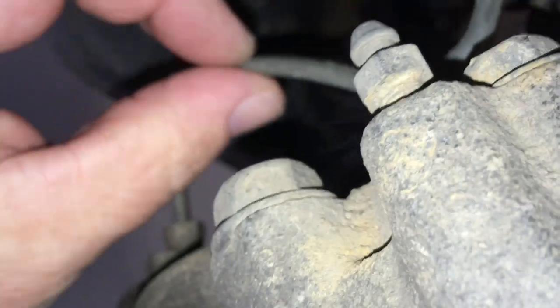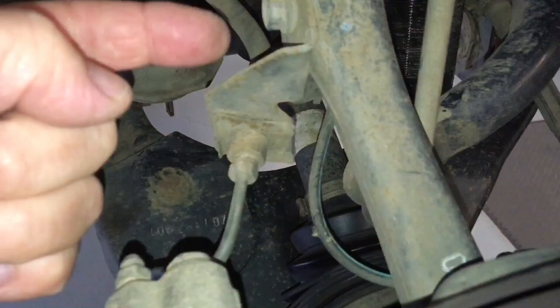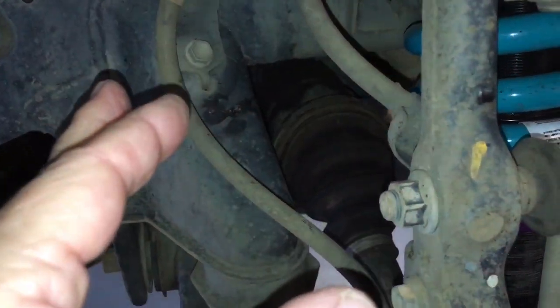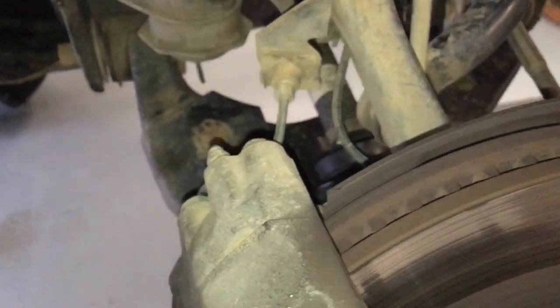What we're not going to do is what the last people did. You can see this brake line here — it's got a bit of a bend in it, looks like it's been bent and straightened, it's certainly not factory. To change the rotors the caliper is quite heavy — very similar to the Prado. Take out this bracket with a 12mm. You're on a flexi hose — I'd rather not hang this caliper on the hose even though it can take it, because the weight of the caliper will still bend this pipe. I've seen these pipes bent really badly.